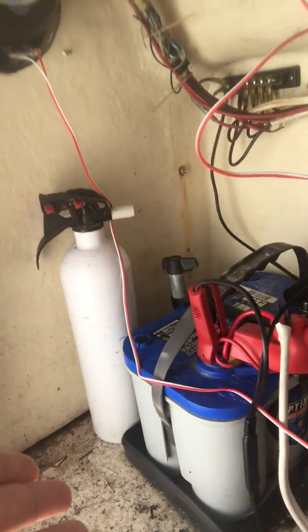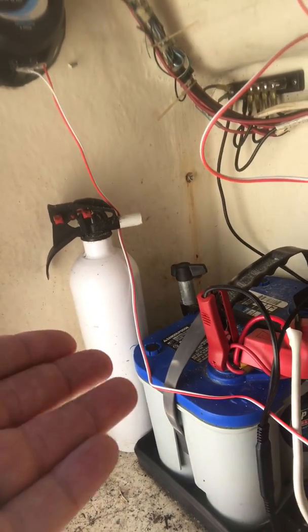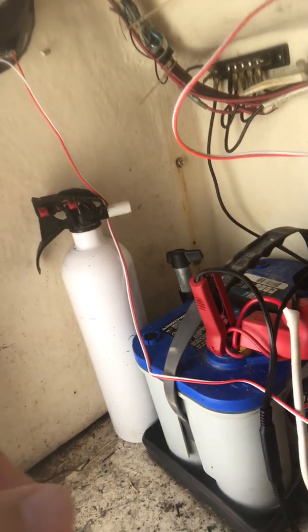And this is what I ended up doing. I took my truck and hooked up jumper cables to it while it was running. Now that's charging the battery without any kind of smart charging capability — there's no sensor in there determining anything. So that truck battery was basically filling this battery, and it got the voltage up to 10 volts. Then I plugged my traditional battery charger into it, and it tricked it — it thought, hey, there's more than 10 volts here, this is a good battery — and started charging.